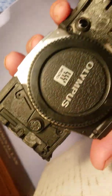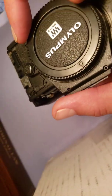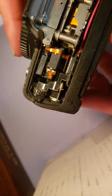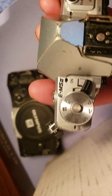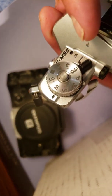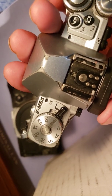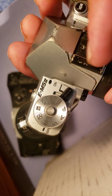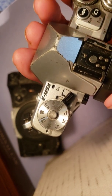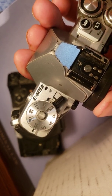As far as designing the camera, it's pretty incredible that they cram so much stuff in here. But there are some things I think were designed for aesthetics and are a poor choice — such as the on-off switch. This one had a problem where the camera was on all the time and could not be turned off. To turn it off I had to eject the battery, which isn't good because the shutter might not close all the way. I would hear a click after I fixed the switch, so I know things were happening that removing the battery was circumventing.